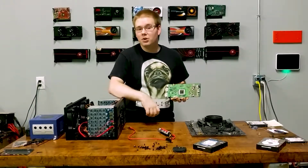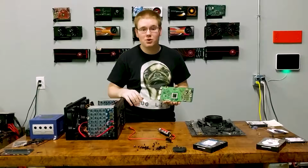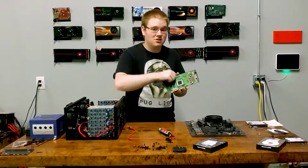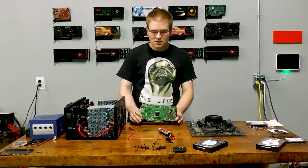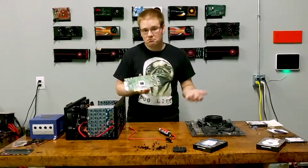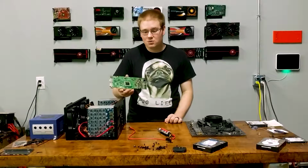So, if you're planning on water cooling by throwing a water block on a used mining GPU, then you should have no problem, because the fans, which would have more wear on these video cards, are of no concern to you, because you're pulling those right off and putting a water block in their place. So basically, in summary, the only thing you have to watch out for if you're going the custom water cooling route is what voltage was used on the card, which you can generally figure out by messaging the seller, and he'll be happy to tell you if he knows what he's doing.